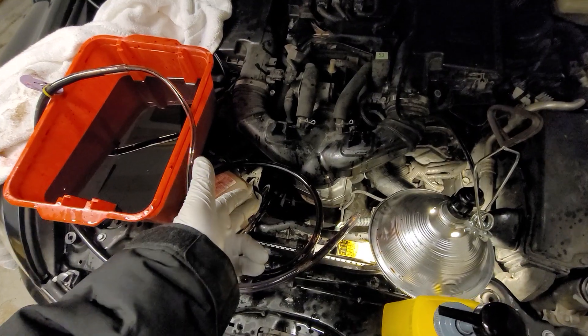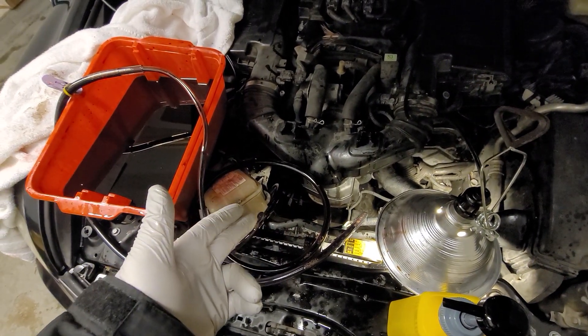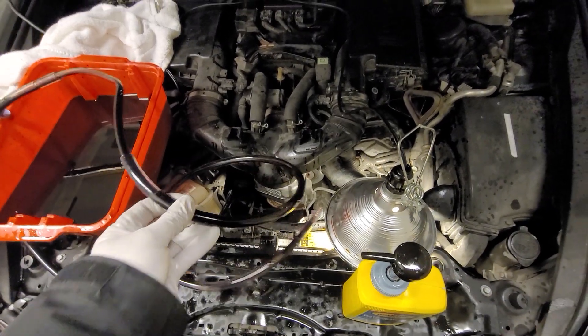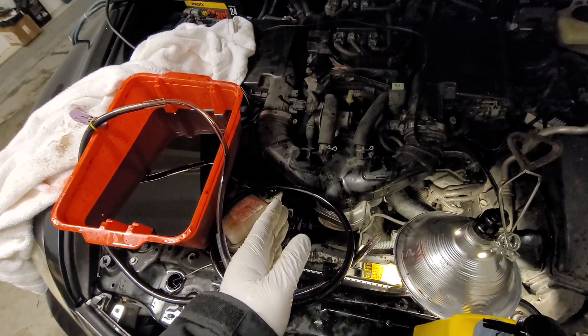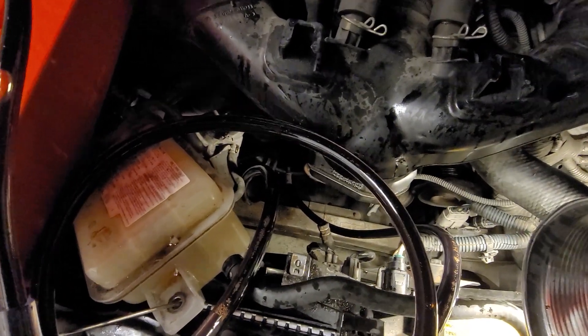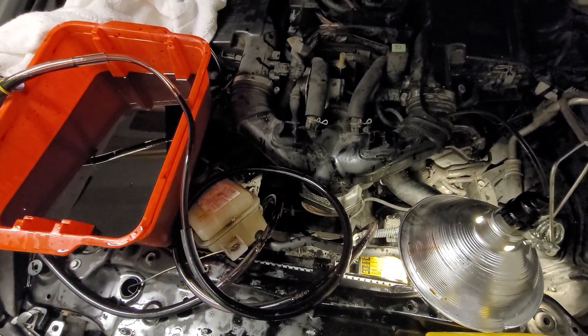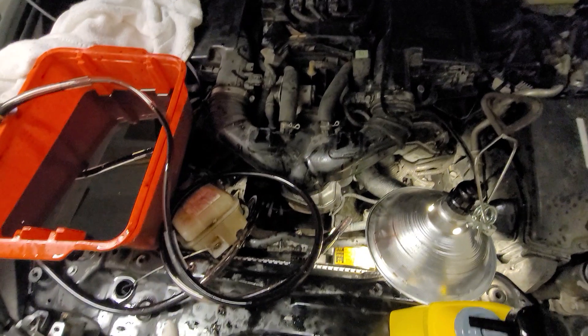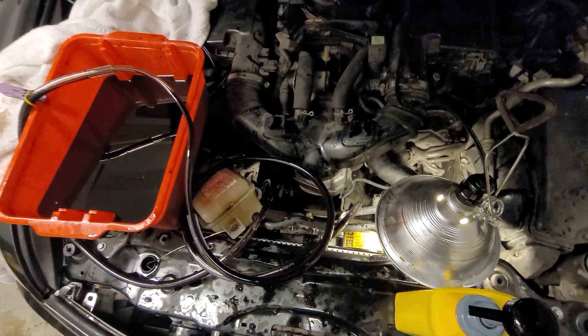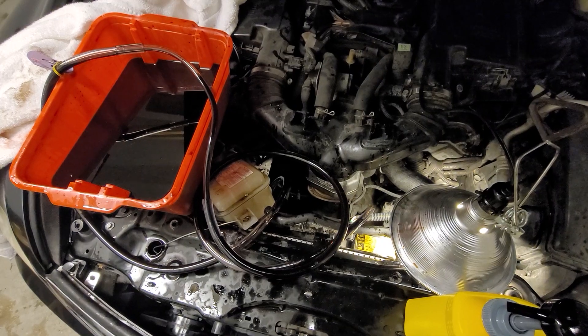I found which pipe was input and which one was output. Of course it was reversed in the manual, so I had to spill some oil because of that. In short, I have a pipe going into the input, and on my car as you face the engine it would be on the right side — the right pipe right there. There are two of them, left and right, and the right one is the input. The input simply drains into the pan, so there aren't any restrictions. If you connect to the output and try to pump oil into it, it will not go — and that's what happened. I was pumping and it just popped and spilled oil all over the place. That's for trusting the manuals.